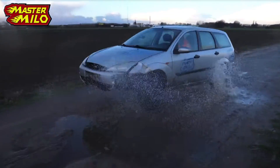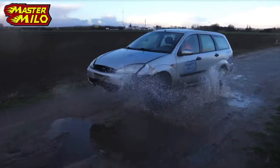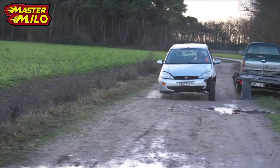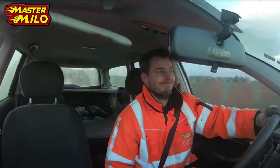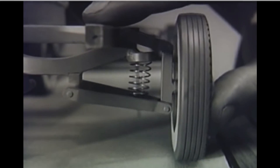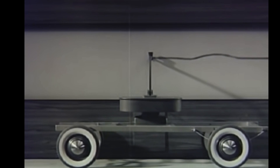Since the load coming from the road transmits through the axle to the car, the chassis will also be violently kicked around in the same motion. This load can cause damage to the chassis and we need to find a way to soften this load. So instead, let's replace these rigid axles with springs. Springs convert kinetic energy to potential energy via compression, so now the chassis is kicked with less energy since the spring is converting some of that direct load to potential energy.